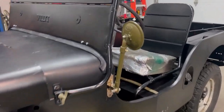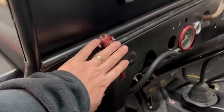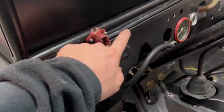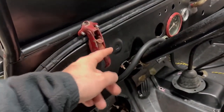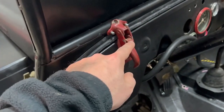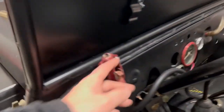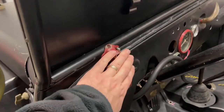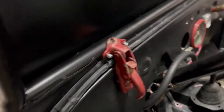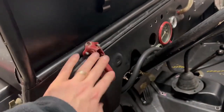Inside, let's talk about the windshield frame clamps first. The ones that came with the body are junk. I'm fortunate I had these original ones — they fit a lot better. The reproduction ones, at least the ones I got, have a lip that's not long enough, so the latch just doesn't catch. On both sides it wasn't catching. I had the original ones, had to heat them up and unfreeze them, fixed some snap bolts, and I'll clean them up and paint them when I paint the Jeep. They work really well — better than the new ones.